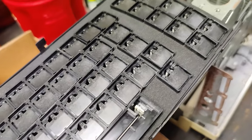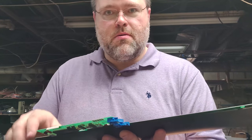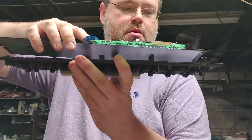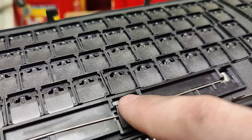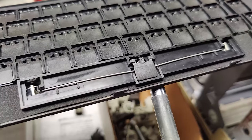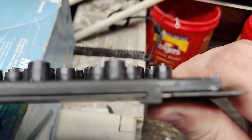Set the space bar aside and work on the printed circuit board and back plate. The back plate got the same etching treatment — reinstall the plastic on the newly enameled back plate, then reinstall the printed circuit board. Be sure to look at the back of the PCB for any damaged traces, because water damage will show up there and your keyboard may not be worth saving. With both halves ready, friction clamp it back together using carpenter's clamps, then carefully hammer it back together. The space bar spring and flapper can get caught, so I like to use a bit to wedge in and force the space bar to be almost ready to pop out — that lets the flapper sit flush with the bottom.